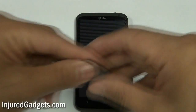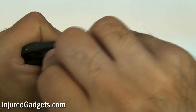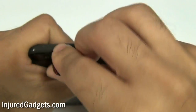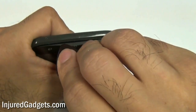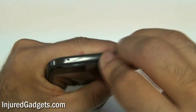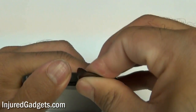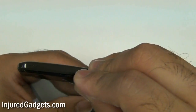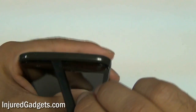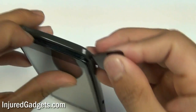You can go ahead and try to separate the front screen glass from the housing. You want to use a safe open pry tool, a guitar pick, and a spudger most likely. Once you've created enough separation, go ahead and use a larger spudger, fit it in between the screen and the housing, and from here on you're going to try and separate the housing from the screen.